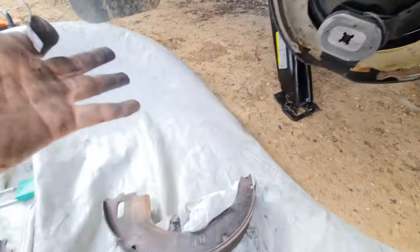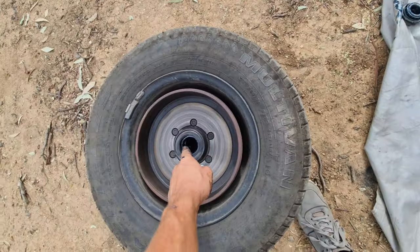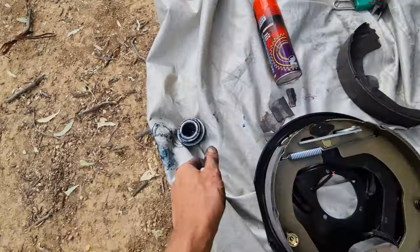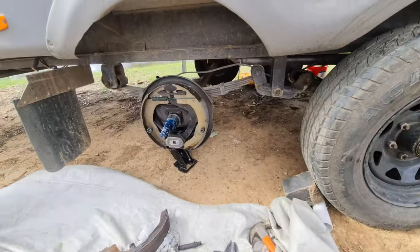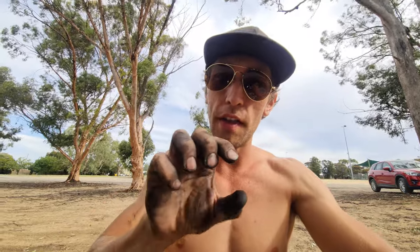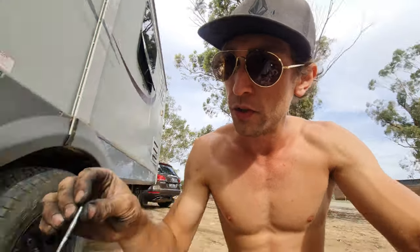Then you just got to put the tire back on. Make sure you get that back in and you pretty much just reverse the process. Make sure you got it all nice and snugged up. Just wobble it a little bit and tighten a little bit. Make sure just until the wobble's gone so it doesn't wobble but it's not cranked on. Then tighten it a bit with a tool and back it off one, and then just put the pin through — it's got a bunch of little holes so you should be able to find one that's perfect.